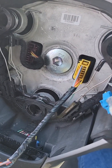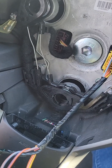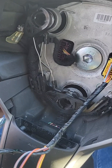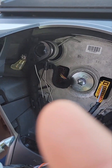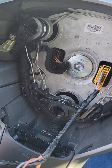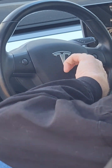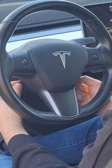Another little trick: when you are putting a screwdriver or allen wrench to that hole, you can see how you can bring it back towards you and snap it off, but you can't really go too far towards the front of the car. So you can always apply some pressure towards the front of the car and you'll never really slip off that spring wire. I can feel the spring on this side — you can see how that already popped this side loose.